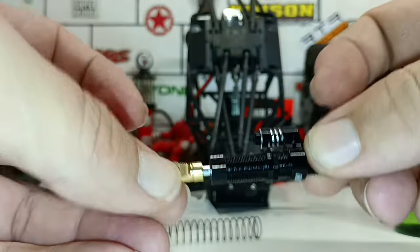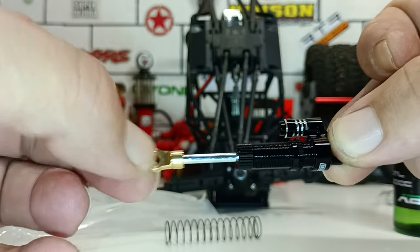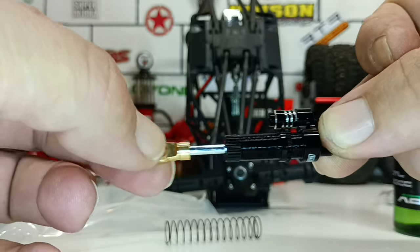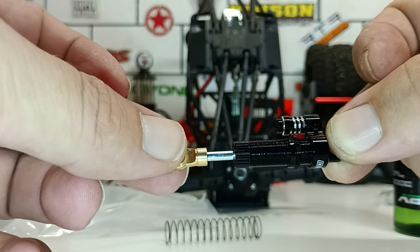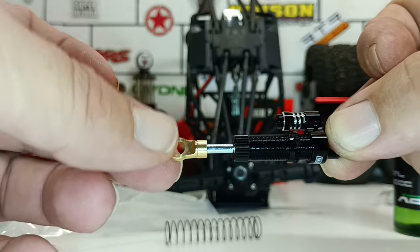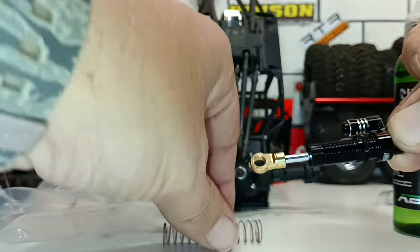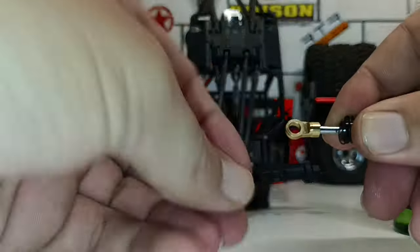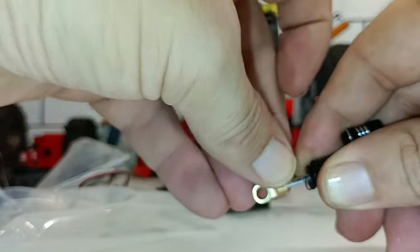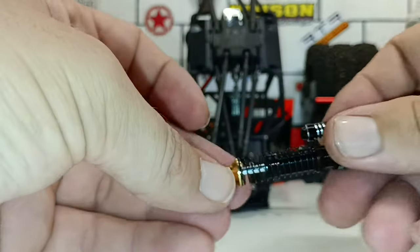Okay, and like this, you end up with a negative, so with a droop setup, keeping your suspension low, but allowing for all the articulation just like normal. Instead of riding at a high height, it rides at a semi height as the shocks are pulling back in. Once you fit the spring back, of course, it will also want to go higher, but it still won't fully extend, only under articulation.